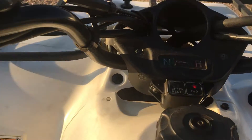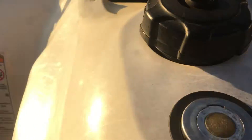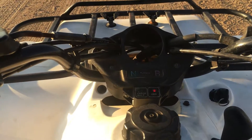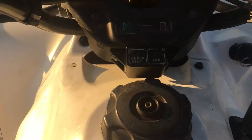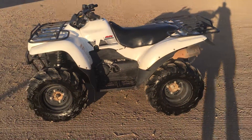You can also do four-wheel high to maintain speed on loose terrain. If things get really gnarly, you go back into low range. Over here it's got a front diff lock — you squeeze that lever in, but you need to be stopped when you engage it. It makes turning really, really difficult but helps in really muddy, sticky situations or loose rock climbing. To disengage, move a little bit and it turns off automatically.